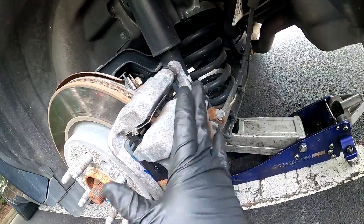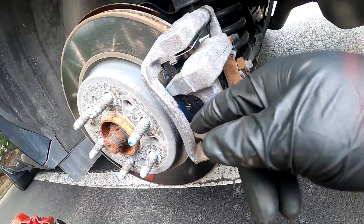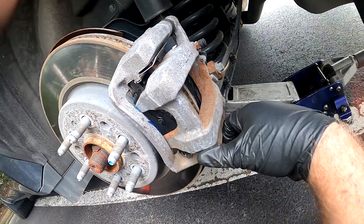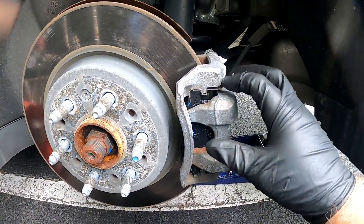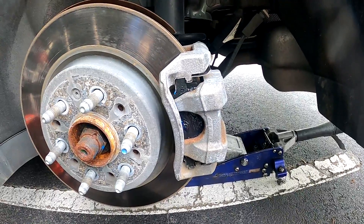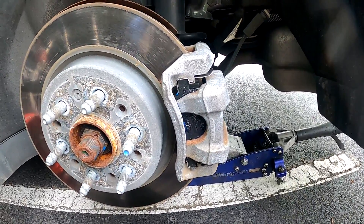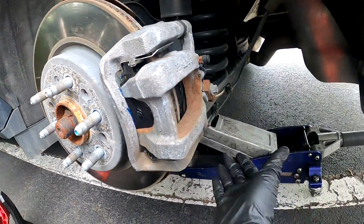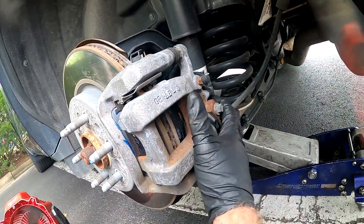Other than that, it's pretty simple — 14mm to take it off. Place your hardware, put brake grease on both sides so it doesn't cause noise from the brakes vibrating. New hardware is always good; it slides on the components instead of being old and rusty where they'll hang up and cause brake shudder, delay, or vibration because the caliper can't move freely.